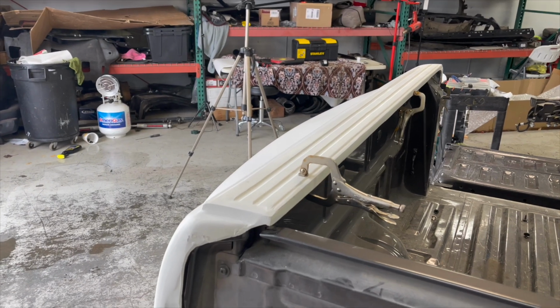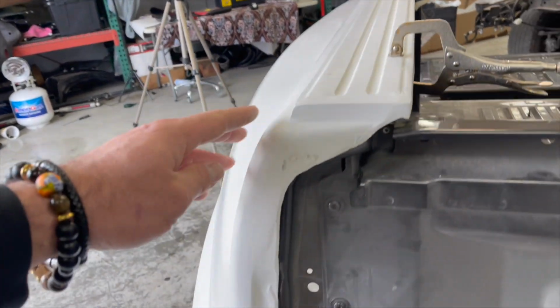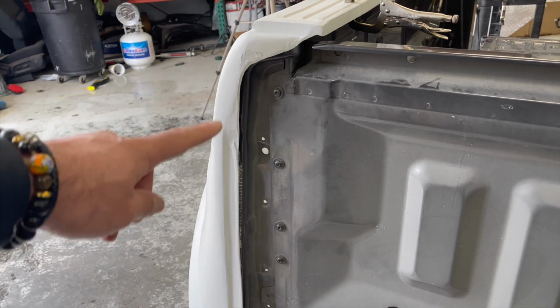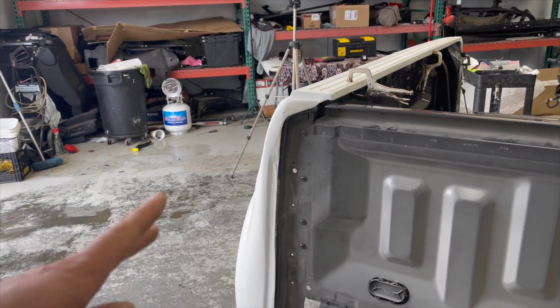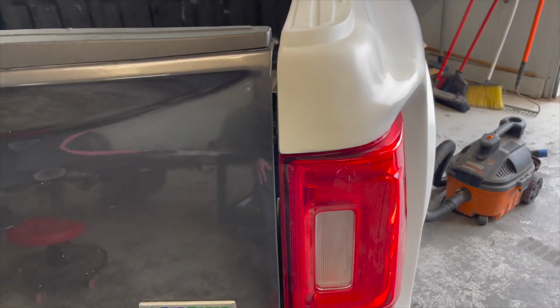The panel is sitting where it's supposed to be. I did put a screw on the bottom, clamps all over. That way, when I'm gonna start drilling, it's not gonna move. We're gonna drill first and then take the panel off, install those little threads, and next time when you put the panel, it goes in the same spot because the hole's already there.